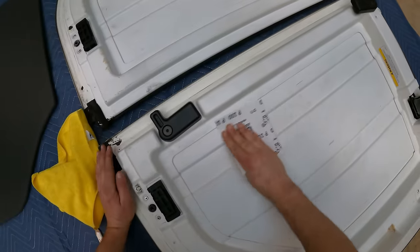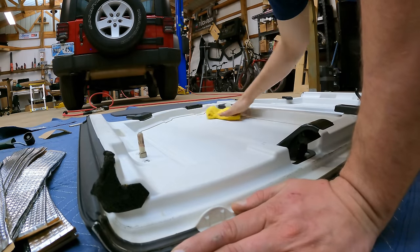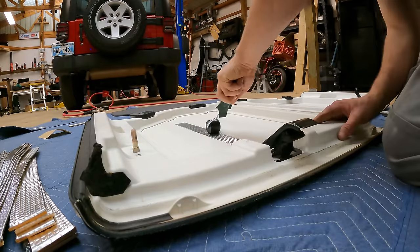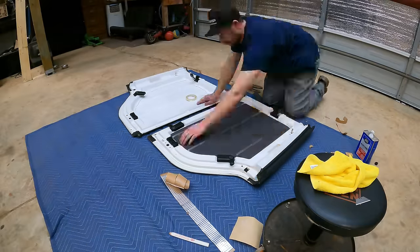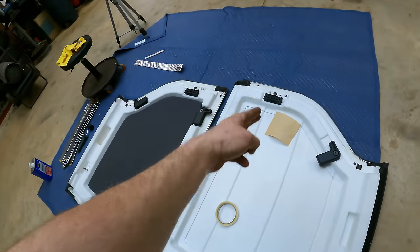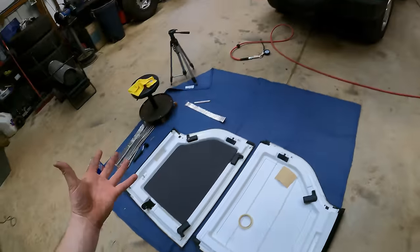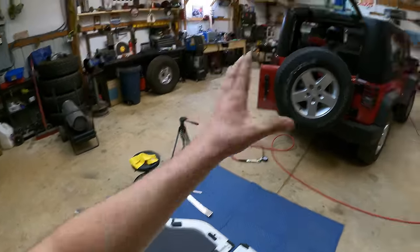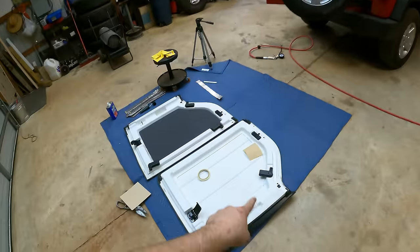To start this off, all we have to do is grab the included sandpaper and lightly scuff the top where the 3M adhesive is going to stick. We'll blow it off, wipe it off, get it really clean, clean the entire thing with acetone, and then start off by putting our Sound Assassin strips down in the channels or the valleys of the top. We'll roll those out until they're nice and smooth, mark our headliner where the adhesive is, stick it down, and press really firmly for about five seconds. I did actually add a little bit more Sound Assassin strip than specified — the kit comes with about 18 pieces and there are a few extra after trimming the hard top pieces, so I covered all the channels completely rather than leaving gaps you can't reach once the headliner is pressed down.